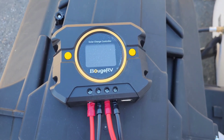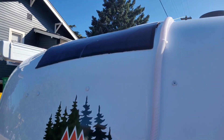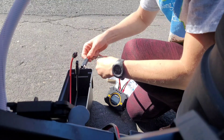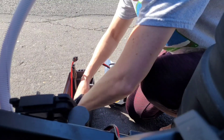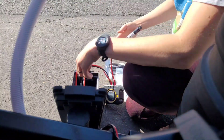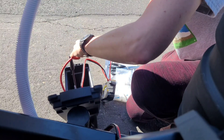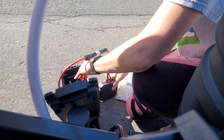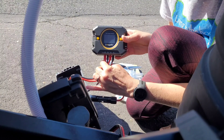It's really important that you hook up the battery first, and it's a really good practice to throw a blanket or something over your solar panel so when you hook it up there's no danger. Let's do this. SAE cable going first. Moment of truth. There it goes — it's on, everything's connected.